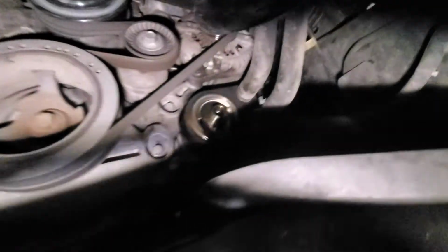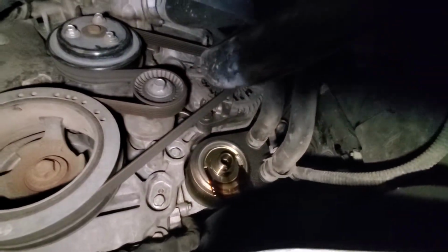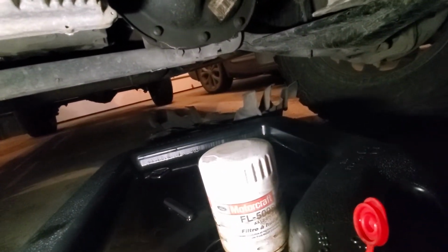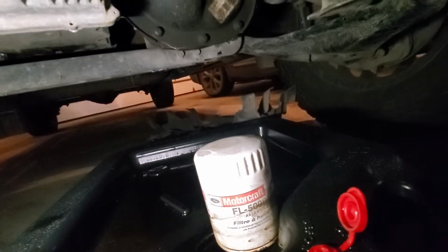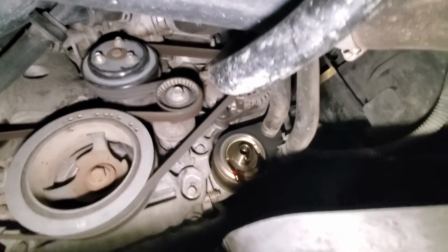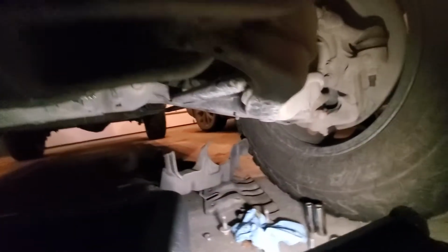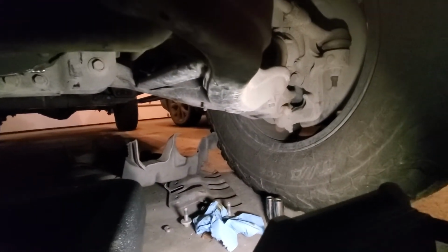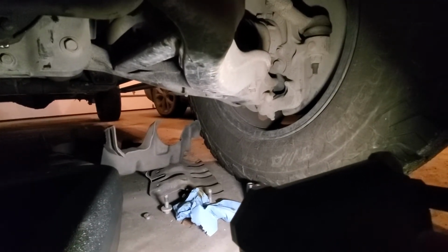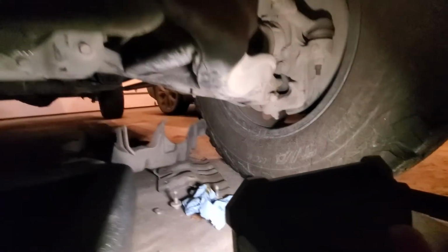The oil filter was located right there where you see that drippy stuff. Currently, I had a video editing problem with the first one and lost it. The filter is turned up right here into the drip pan so the rest of the oil can drain out, and then we can throw that away. But it went right up here underneath the front of the truck. And then I also removed this underbody paneling piece over here, size 17 bolts and also size 1/2 inch, because a bolt was misplaced before I bought the vehicle and I had to put a new one on there.